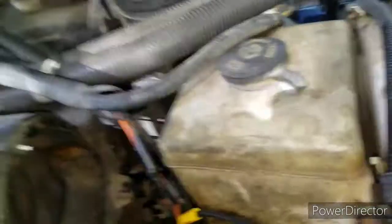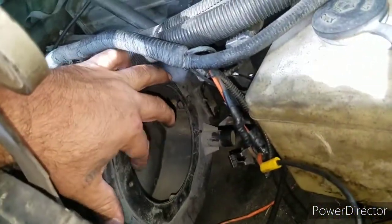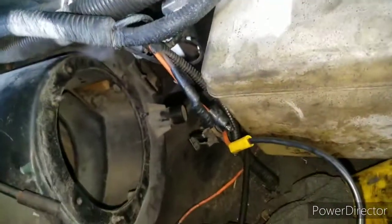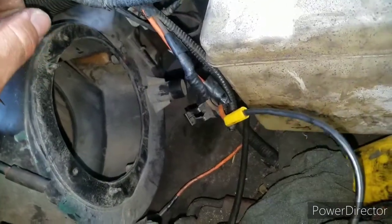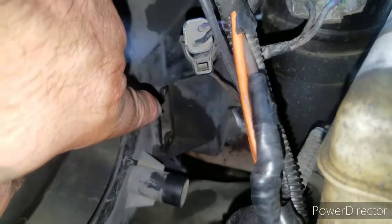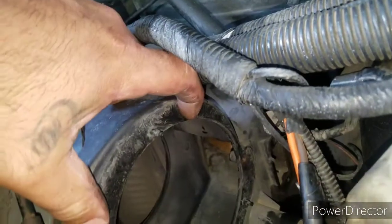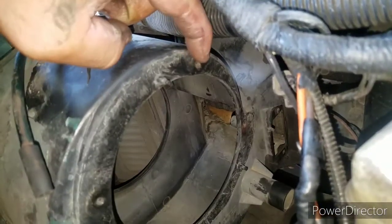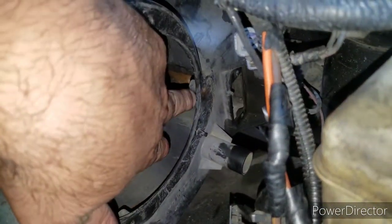In order to take off the fan, you're gonna need to get in there and clean it out — there's probably gonna be some leaves and whatnot in there. So you're gonna have to clean out some leaves and pine needles if y'all have pine trees around. This hole right here is where the resistor goes. You have eight millimeter on top, eight millimeter on bottom. The fan has four eight-millimeter screws — one, two, three, and four.